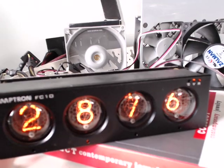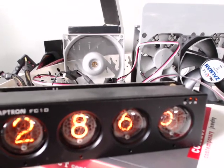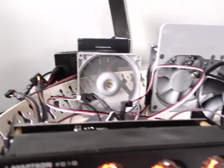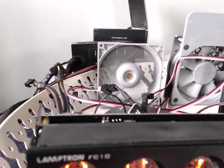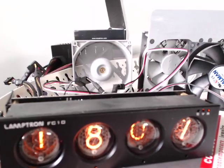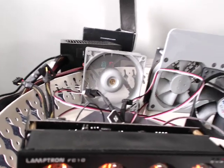So they run at the Zalman rated speed with the Zalman motor in them, so they will run roughly about 3,000 revs. So swapping the motor in from the Zalman doesn't degrade performance at all. Does give you easy controllability though. And you could take the same principle and you could transplant the internals of a pulse width modulated fan, something like that. You don't have to go with just an ordinary one. But this is a pretty cool way of reusing the G5 fans.